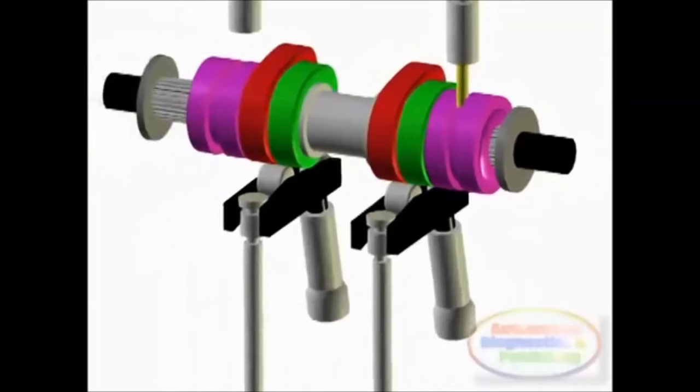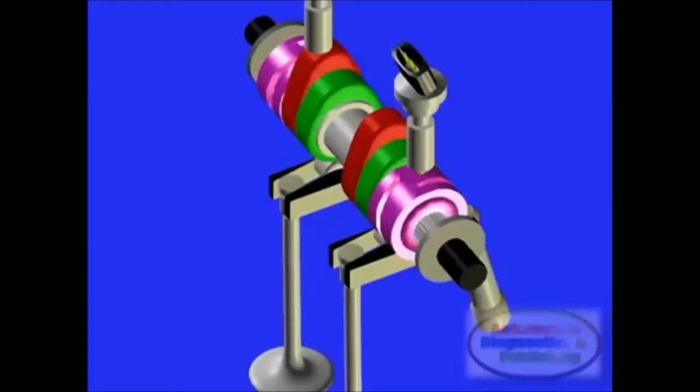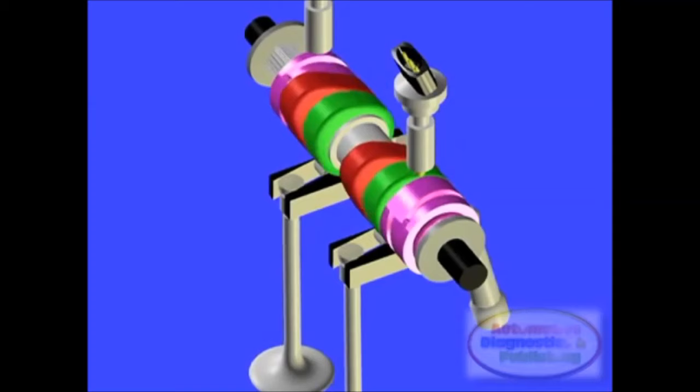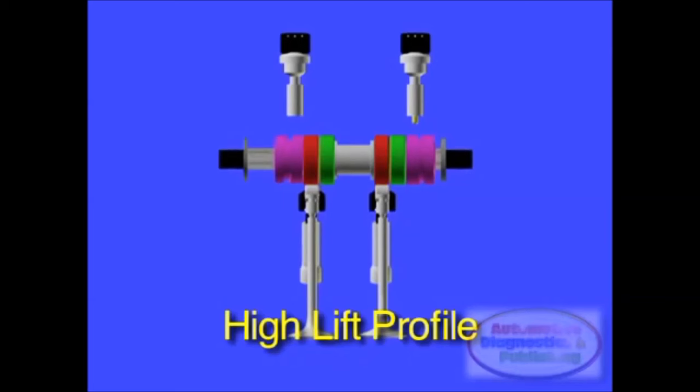Audi engines have already been carrying the variable valve timing for many years, and this is in addition of valve lift. Compared with Honda or Toyota systems, Audi is a simpler and more efficient system. It actuates the variable lift without using complex intermediate shafts, like hydraulically operated rocker arms, and it saves space and weight while reducing frictional loss.